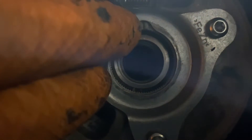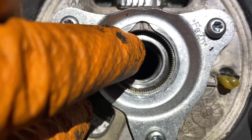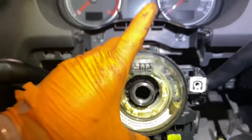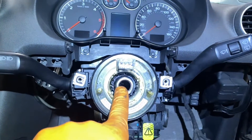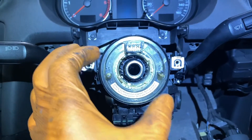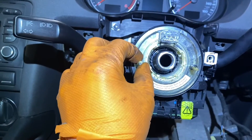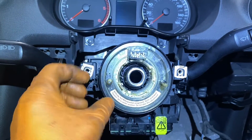We're pulling out the steering wheel — it's a spline key, not sure what size yet but we'll find out. There are two very small nicks on the spline to line up the steering wheel, better visible with the light on. Once the shear bolts are out at the top, this whole thing nearly slides up. Be very careful that the clock spring doesn't start turning — the clock spring, steering column and all of that must stay in its specific place. I'm going to slide it off carefully and put it back in the same position. If in doubt, put a bit of tape or a tie clip to secure it.